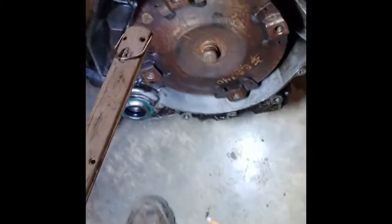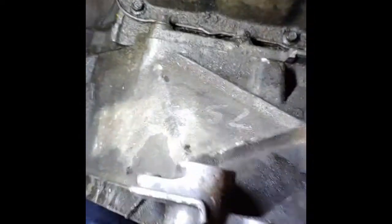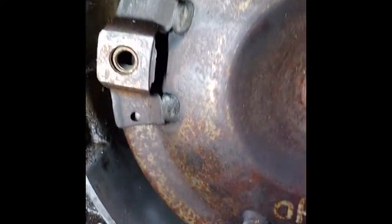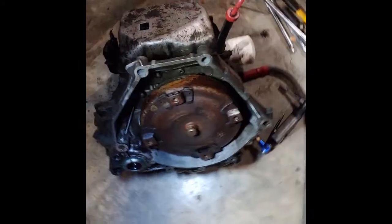Alright, well, this is part 2. Now I think somebody changed out the transmission in this thing, but I think they got a junkyard one, because it's got writing in paint marker on the transmission there and there. I don't know if you can see it or not, but the crack, see it right through there and all that gunk. This thing's been leaking. You can see the transmission fluid right down in there, and where it's been slinging it around everywhere. I don't believe it's the rear main seal, because all that looks dry. So I do believe the front seal on the transmission was bad anyway, thinking that something might have happened to the pump inside of it.